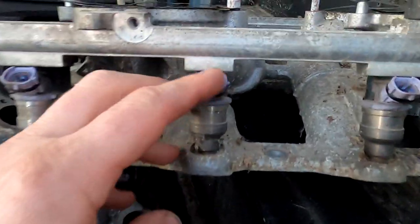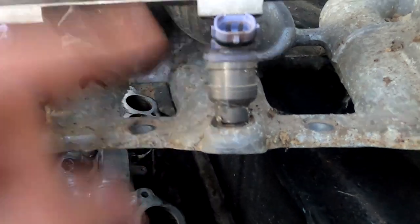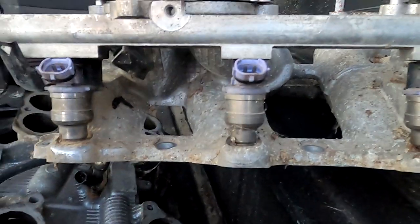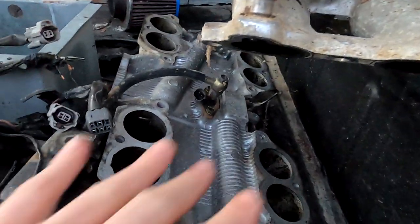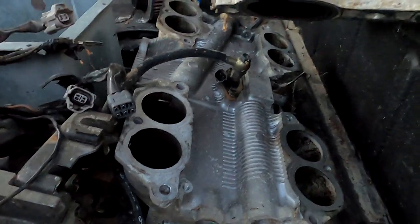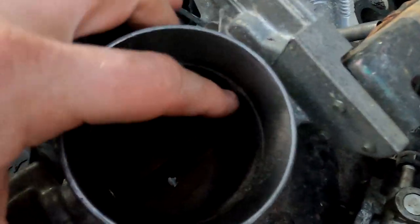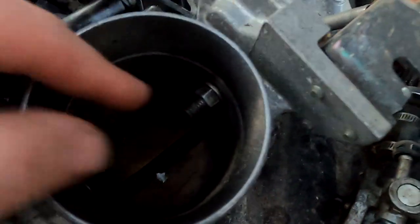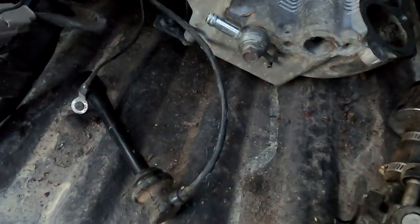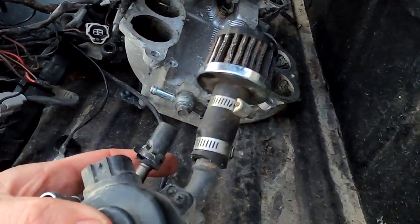In the back we find the intake manifold with small injectors. I'm not even going to bother servicing these — I'm just going to bin them and put on a brand new set of injectors. Cold start injectors are going because it's got an aftermarket ECU. Throttle body — there's a bolt in there that's going to go. We're not having a nut inside the throttle body. Idle speed control is getting changed to a two-wire.